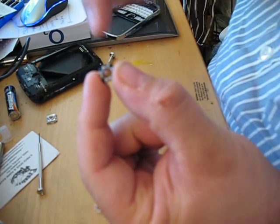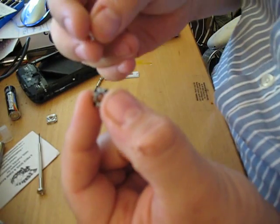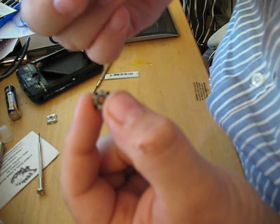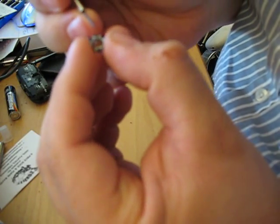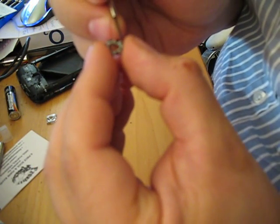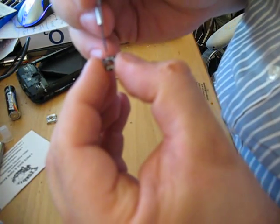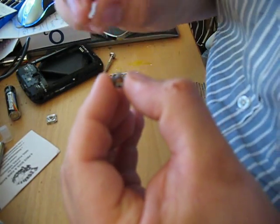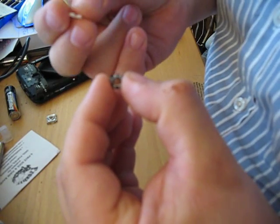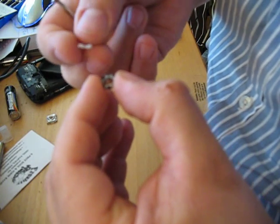If you've got it in focus — there's a ball in the middle and there are four of the roller balls either side. Now you need to make sure — I haven't made a mental note of which way round this actually goes. Okay, you can now put that plastic thing back in, but before you do that, you need to just push in and bend back the four metal clips that are either side, so when you go to put the plastic thing back in it actually holds it. Now I just need to put it the right way up, which is the long bit — that long bit sits on that way up, the right way round.